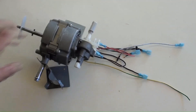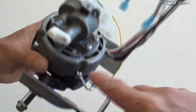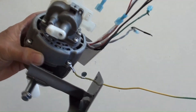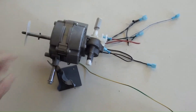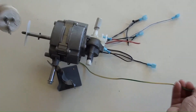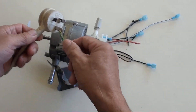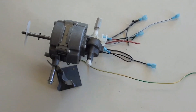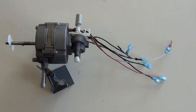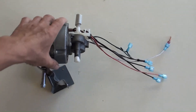Incidentally, although this motor has no earth wire, one can be added — with one end of the earth wire screwed to the motor's body and the other end connected to the larger pin of the power plug. There is no earth wire among these wires, but we still need to find out which wire connects to which, for the sake of the capacitor and power connections.